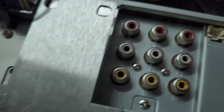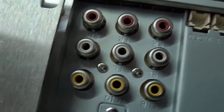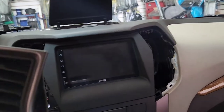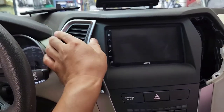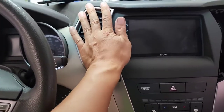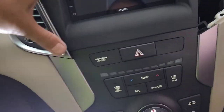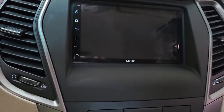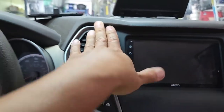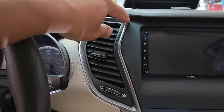When you're done, you want to hook this thing up to the rear view camera. Most of this will tell you — it says 'R-C-I-N,' meaning rear camera in. You want to hook up in the middle right there. Now I'm just gonna hook up the air vent back. Your left, your right — just kind of go easy on it. One hand isn't so easy. Make sure it's in and kind of push it in. One thing I would like to remind you — make sure it's even. You don't want it higher or lower when you try to put it in. You want it straight, even like this, and go in. Because if you don't, you're gonna have to take it out and redo it again.